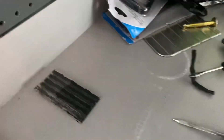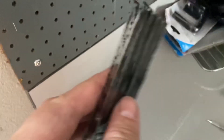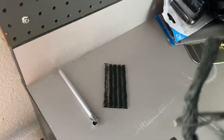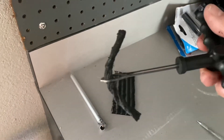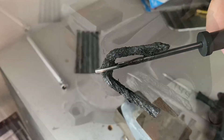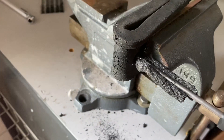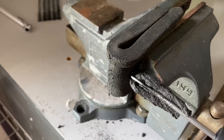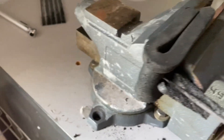Next, you're going to take one of these little sticks here. They're very sticky — they remind you of tar. You're going to insert it into the plug tool like that, halfway, and then bend it upward like this. So you're going to go into the hole with the tire repair piece folded in half in this direction.